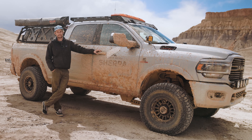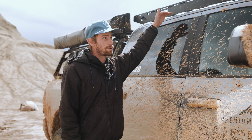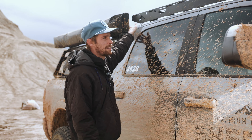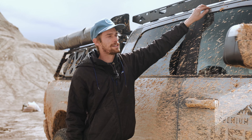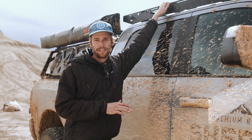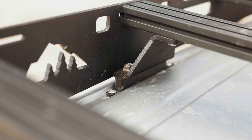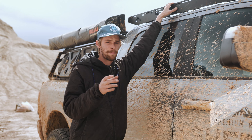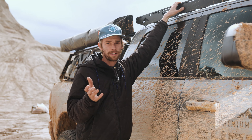One of the first things I want to mention about this rack system is it does require drilling into your truck. Sadly there's no way around this with the Rams — they don't put anything in there to mount to. Unless you were to clamp like the door sill, but then you get into your weather stripping and we just don't like that. We try to make it really easy with our drill racks using our billet rivet adapters, which require two 3/16 holes per mount to be drilled into the cab, and then you install a 3/16 pop rivet.